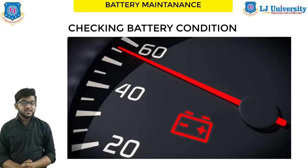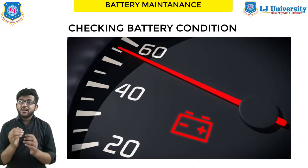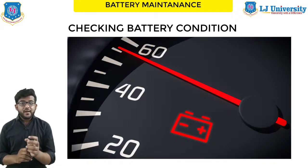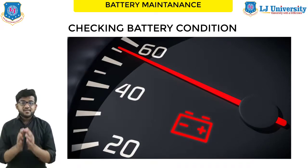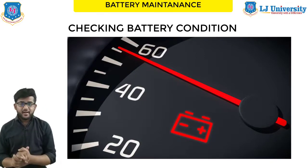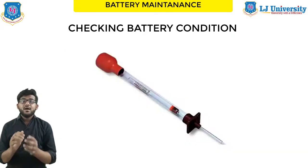Next is checking the battery condition. When measuring the battery charge, you check the condition of the electrolyte and battery plates. As a battery becomes discharged, the electrolyte has a larger percentage of water because the acid is used up. Thus the electrolyte of a discharged battery will have a lower specific gravity number than a fully charged battery. This rise and drop in specific gravity can be used to check the charge state inside the battery. Non-maintenance-free batteries can have their state of charge checked with a hydrometer.